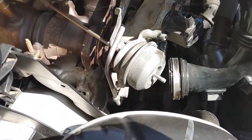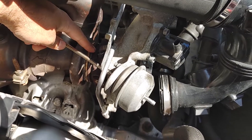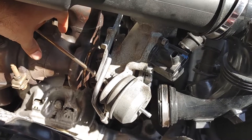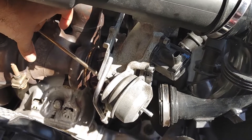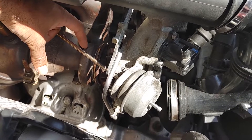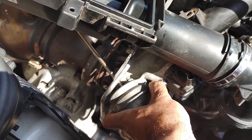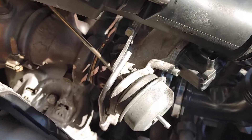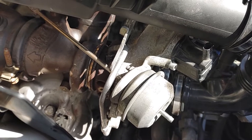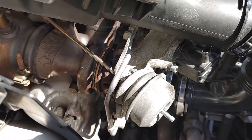There's another video on YouTube where the guys disconnect the wastegate and act like you can slide the turbo out of the exhaust manifold. You can't. I soaked it in aero-kroil, tapped it with a hammer, heated up the exhaust manifold side with a torch to expand it, and grabbed on with gloves and wiggled. The turbo doesn't really come out. I talked to a Mercedes service technician and he agreed that it's sealed up from the factory, not really meant to be removed.